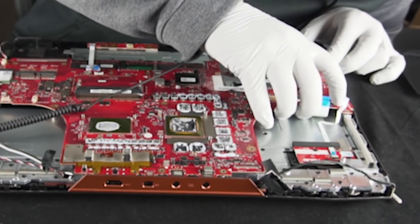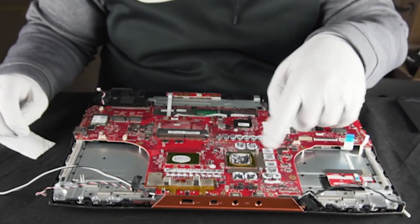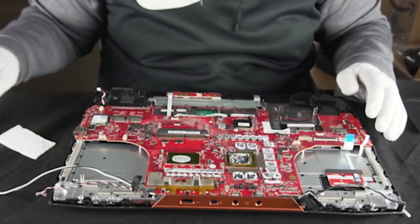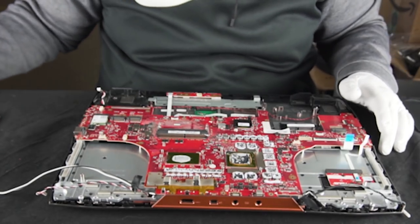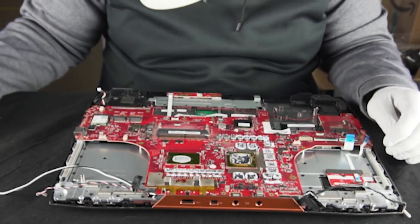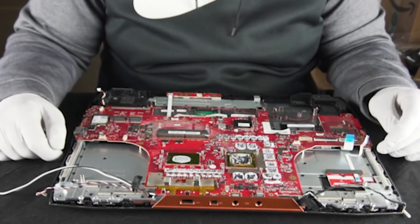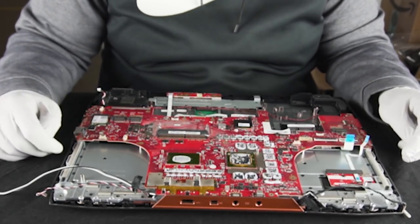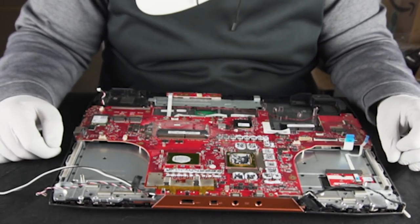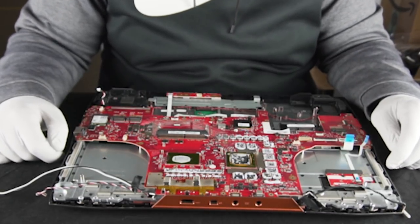Apparently this is not sitting down like I want it to. So typically like GPU memory — these chips here — are stupid fast, like 5,000 or 6,000 megahertz, potentially up to 12,000 or some absurd number. So if you're running slow memory on something where your GPU is going to be using your system memory as its source of memory, that's significantly slower than these chips. The fastest you can make that, the better. Will you always get better performance if you have faster memory? Yes, you will.